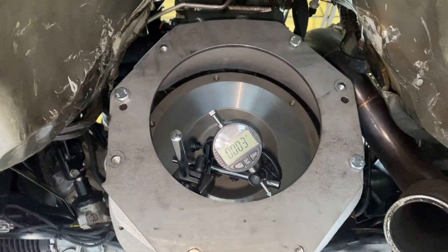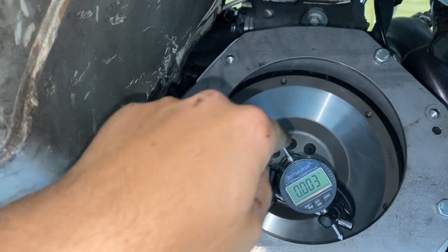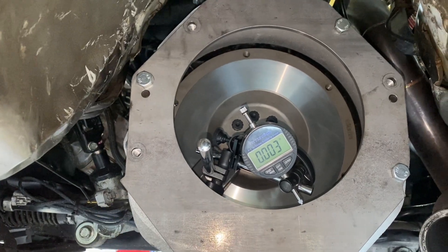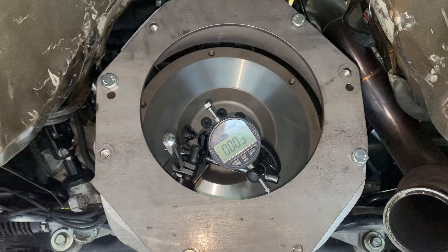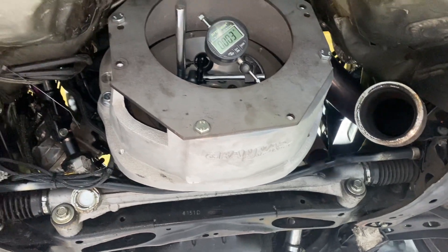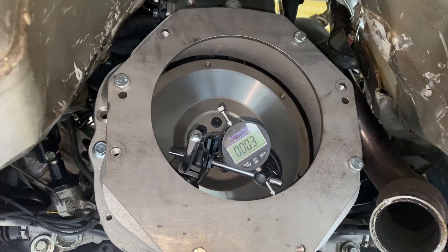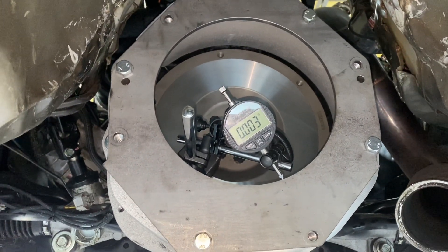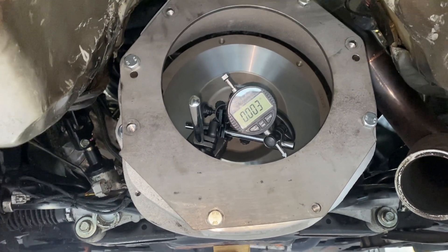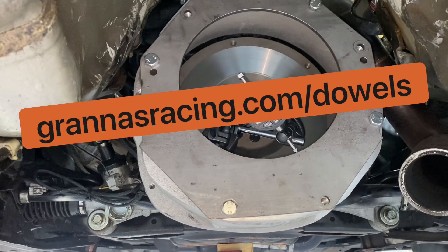For a high-performance motor, you want to be within 5 thou or less on indexing. What's bad about being out of index is it puts the input shaft on an angle going into the motor and into the pilot bearing, which puts stress on the front or back side of the gear and can wear it out, put too much heat in the back of the gear, wear out the input bearing, and make a lot more noise. Even with my cast aluminum bells I now always index these. We've found more tolerance differences in the 2JZ Toyota blocks — this was a bone-stock motor and my bell was machined to within 2 thou, but the Toyota block itself was 11 thou out. Offset dowels fixed it.